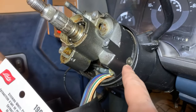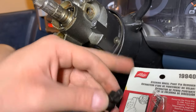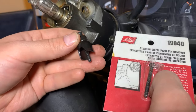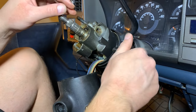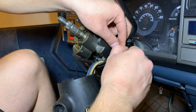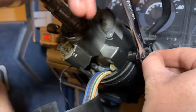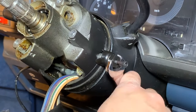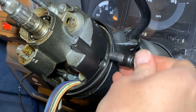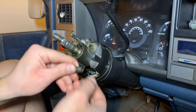We've got to pull these pivot pins, so I picked up this little pivot pin puller tool — it's got a little threaded bolt that will thread into the pivot pins and a nut that pulls against that bolt. There's one on each side, so we'll screw that in and eventually it's loose enough that you can just pull the pin out. There's another one on the other side — we'll do the exact same thing. Got the pivot pins out.